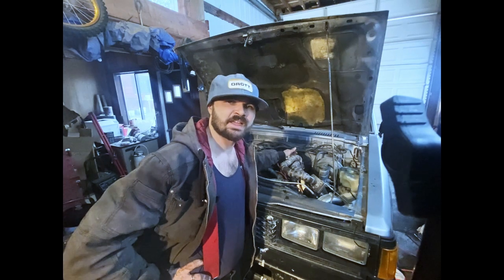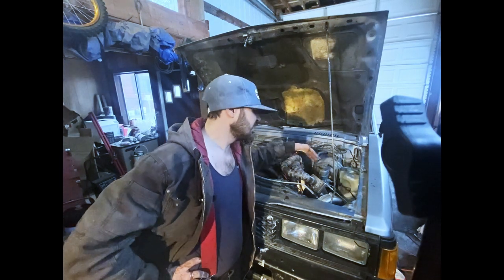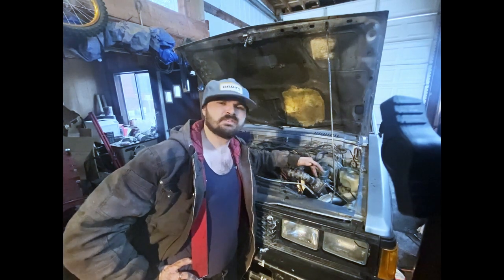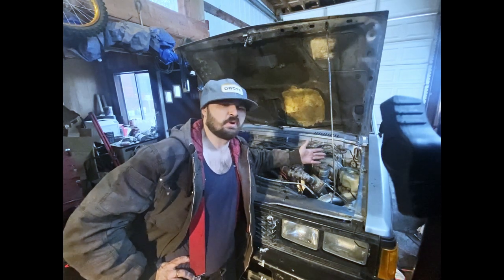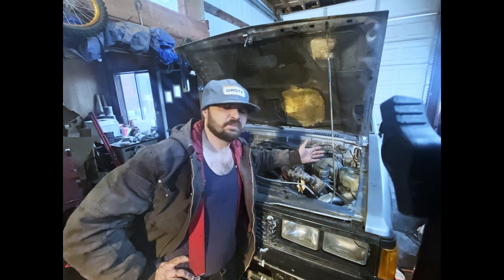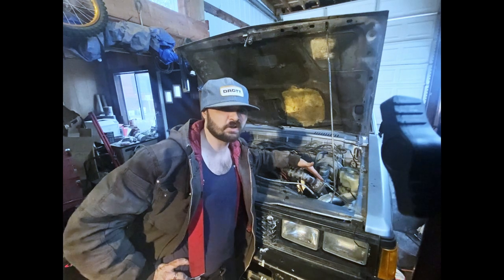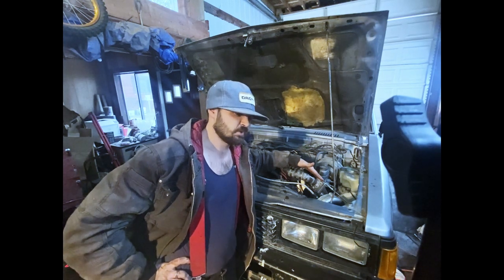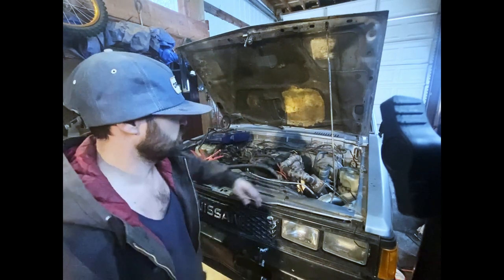We're going to go ahead and take it all back apart, apply some anti-seize and some silicone, and throw it back together. I still don't have a gasket for this T3 flange, because for some reason, who I bought it from didn't send a gasket. I don't know why. But I'll go ahead and silicone that, and hopefully that'll last for a while, just so I can try and do something with it. I'll wait until the gasket. Let's begin.